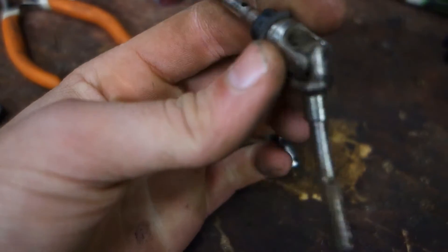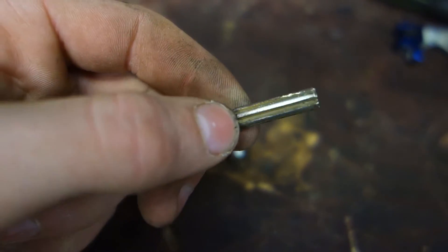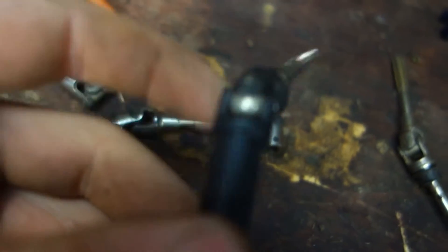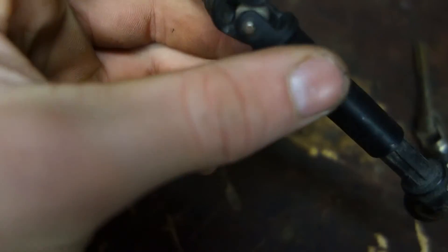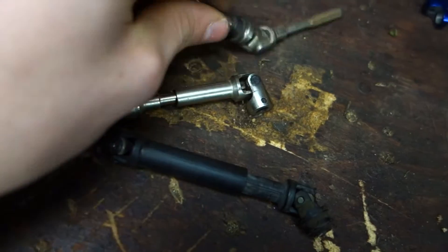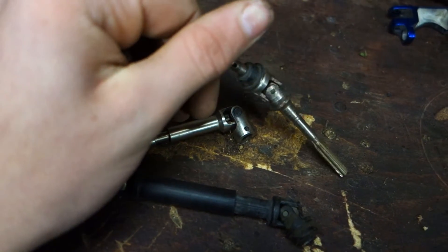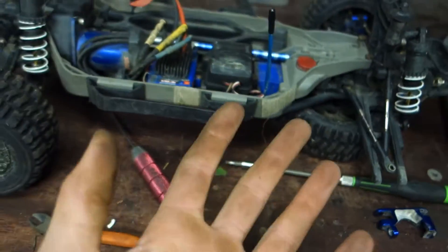There's an off-brand eBay axle here — it's steel, that's why I bought it. You can see a little bit of rust on the spline. Notice how they have square U-joints where the Traxxas ones are ball-style. These can get to a much higher angle and still turn freely, where the Traxxas ones will bind if you increase the angle. But on the Slash 4x4 you don't really have much angle, so they're okay.